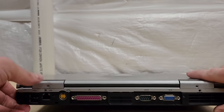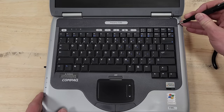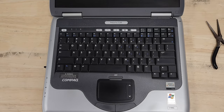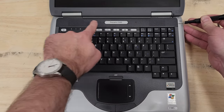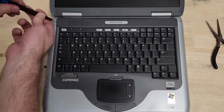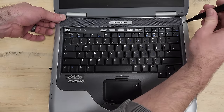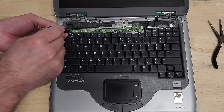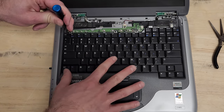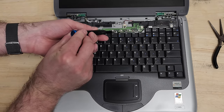Man, I hate working on laptops. I cheated and did a little Googling — there's always some plastic piece you have to pry up. I'd rather not damage this thing in any way; it's in pristine condition and I'd like to get it working. Pretty nice looking laptop. So we're removing this whole piece here including these clips. My strategy here is that I'm removing the keyboard. There's a screw in here holding everything together from the middle, and all the outside edges crack apart. Something's holding this up in the middle — my best guess is that it's under the keyboard.